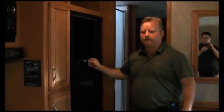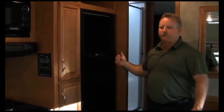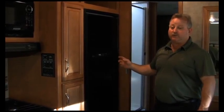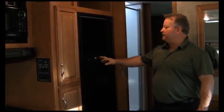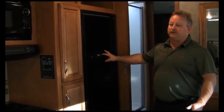Refrigerators — the modern refrigerators you should be able to turn to auto. They are two-way refrigerators, meaning they will run on 110 power or propane. They require a little bit of battery power to tell them what to do because the brain works on 12-volt power, but the main cooling works either on propane or AC power. These are much slower than your refrigerators at home — allow a minimum of eight hours for them to get cold. If they're full of warm food, it can take a whole day.